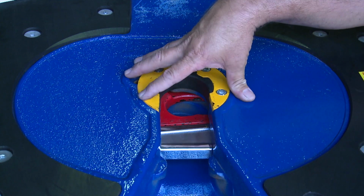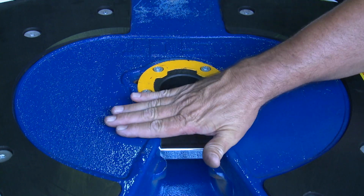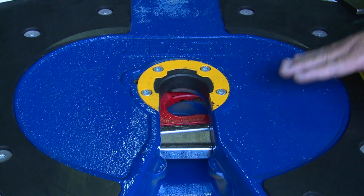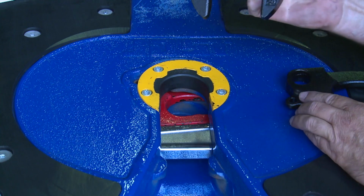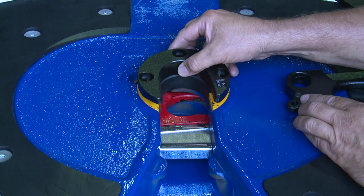That's the fifth wheel fully locked up at the moment. The lock jaw's in the closed position, the lock bar's gone across behind to hold it shut. Just to show you those components out of the fifth wheel, here we have our wear ring. That's the one that sits in the top.